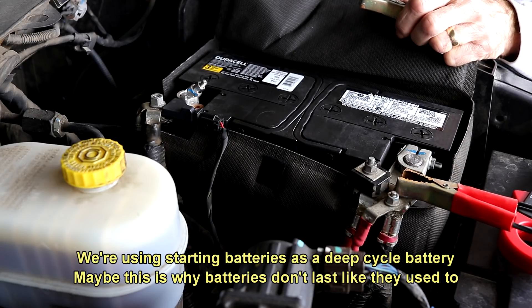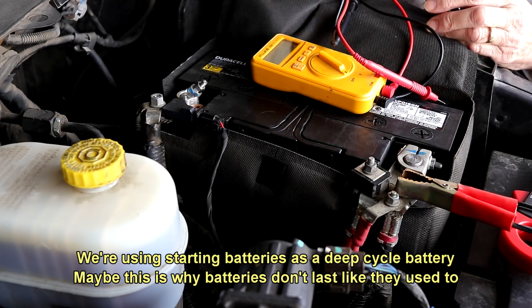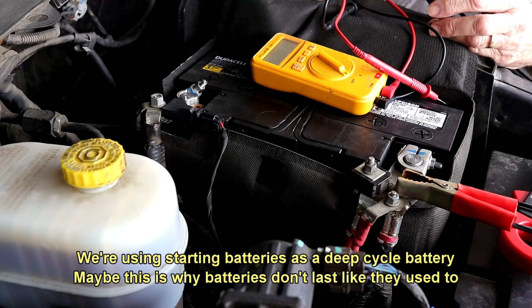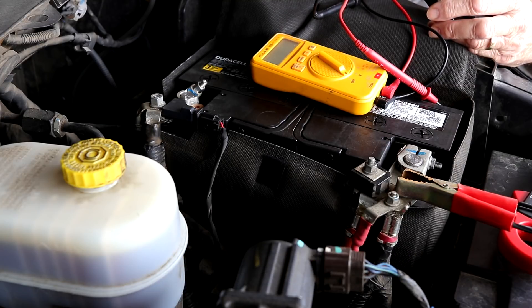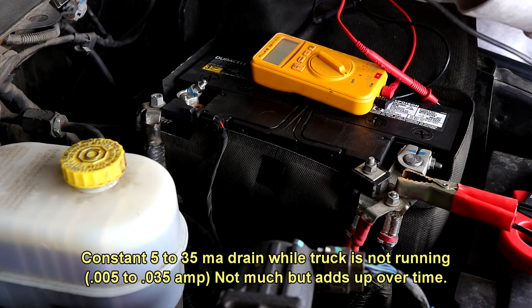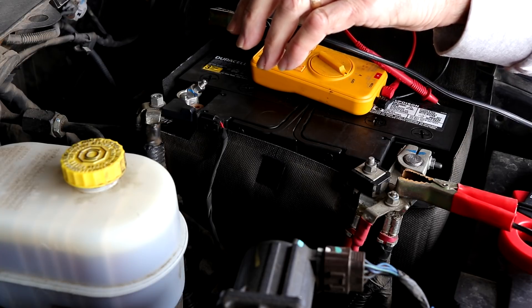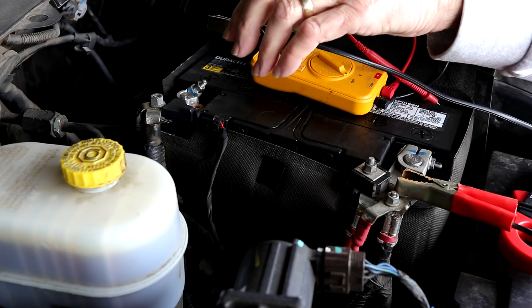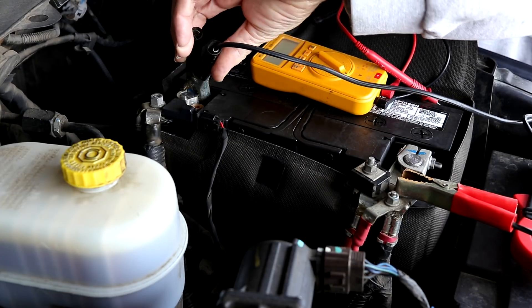12.46 — that's about 80%. That's not a fully charged battery. The reason it's like that is because it's been sitting there since Friday without being used. The manual says if you don't use your truck in 20 days, your batteries could be drawn down to a point where the truck won't start — because there's a parasitic drain on these batteries all the time. The PCM and things are going on behind the scenes in these trucks. So I'm going to go ahead and put this old Schumacher on it.